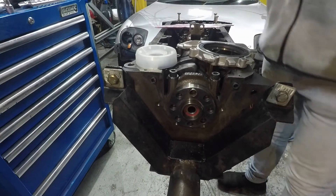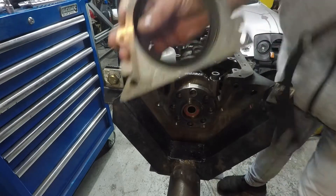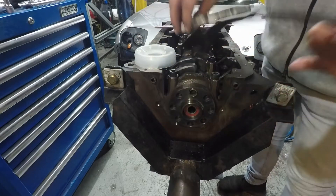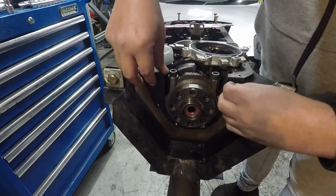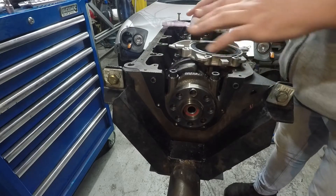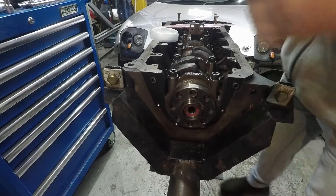Alright, let's get to putting on the rear main seal. First thing you need to put on is this little cover here, and you will have a look on the actual bracket itself. There's a tapered hole, so you will try to line that with the tapered hole that's on here. The good news is this should go straight onto those dowel pins on the back of the engine. I prefer the metal ones for this. You can get the material rear main seals or the paper sort of gasket ones. I just find that the metal ones on the cast iron block — I've never had an issue with.